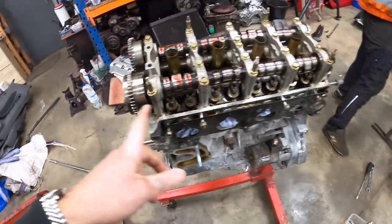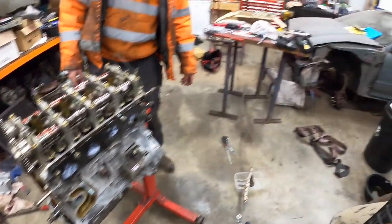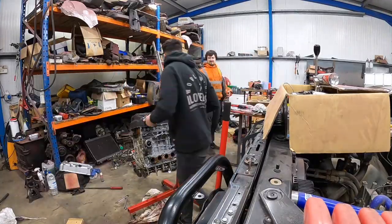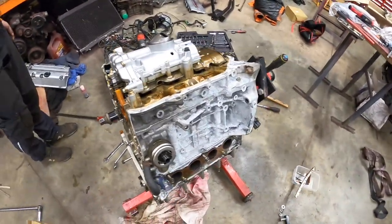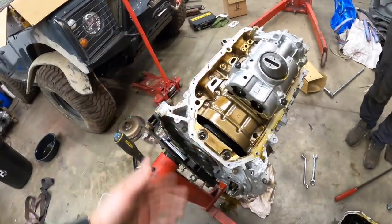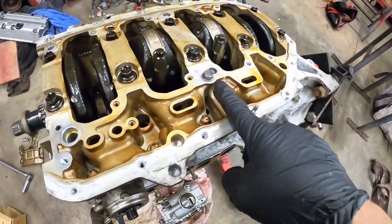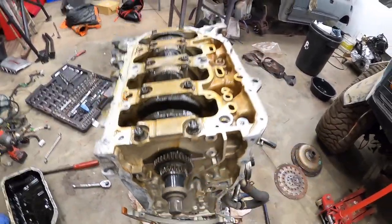We're just tapping down the new K20 inlet cam. I'm going to flip it over and do the oil pump and stuff — I've got everything laid out ready to go. I keep banging on about how clean this engine is, but we just pulled the sump off and it's literally spotless. I keep getting upset because I'm replacing stuff that's really good with stuff that's new. The K24 oil pump is off. We've blocked off this little oil jet that Josh said will eat my bearings if I don't. Now we've got to modify the oil pump for this bit of crank gear that's beefed up.